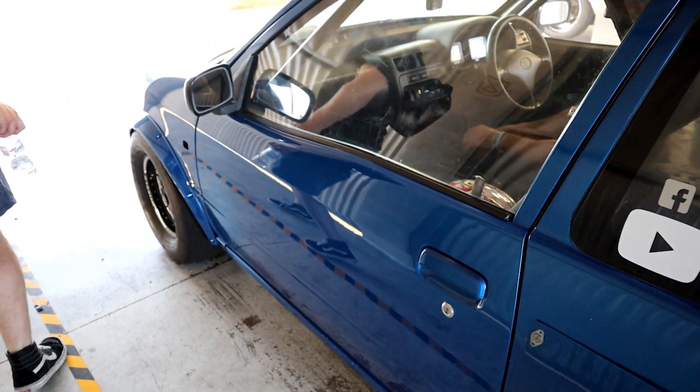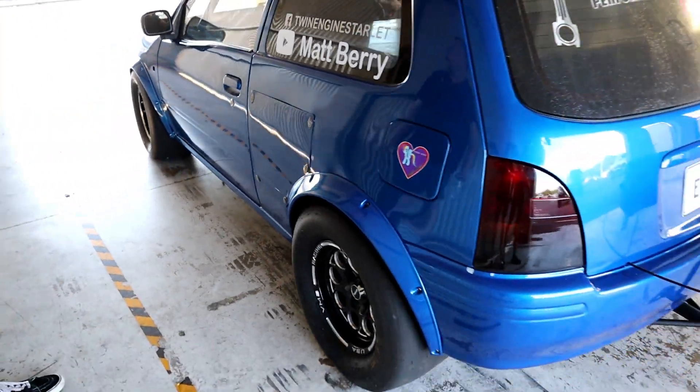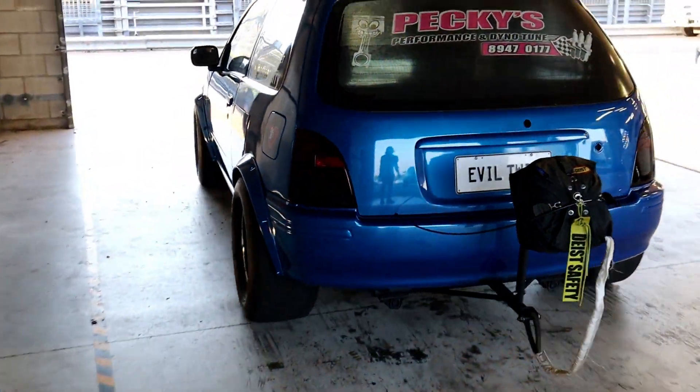We're coming through the gears in a rolling start - second peels, third gear just peels and fourth gear is peeling as well. And when we've got 100% traction on the back, it tends to steer the car over to the left and kept pulling me over into the left lane. So the solution to this is we've been trying to figure out a traction control system and how we can manage the wheel spin that's happening on the front.